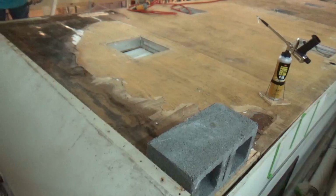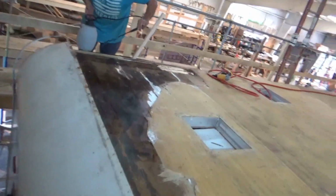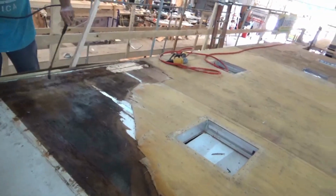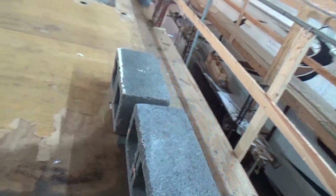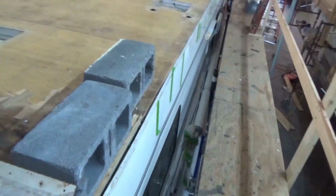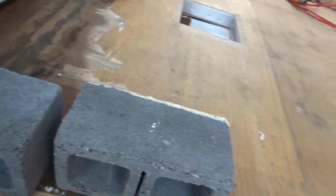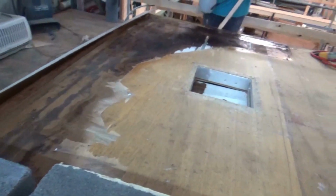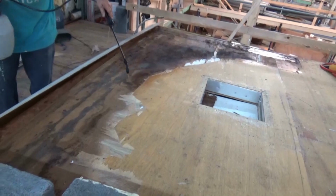More to come. All right, there's our Coachman, this Class C that we've been working on. We had some damage in the back, and what we're doing now is spraying mold kill on there. We just want to make sure there's nothing under there. And then we're going to relaminate this roof. We're going to soak it down, and once it dries, then we can get working with it. We just stitched down a little piece under here. It looked like it was sticking up. It's just shear strap that they use at the RV centers or the manufacturers. It's a piece of metal that runs along the whole edge right there, for shear factor, meaning racking, and to kind of hold it together. It's an extra they put in there. Once that cures out, or dries out, then we're going to be putting the decking on.